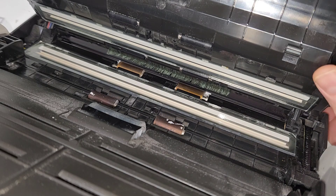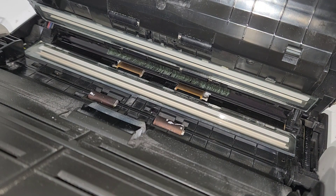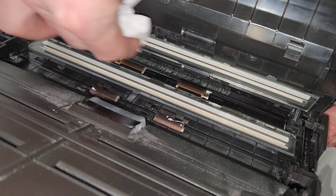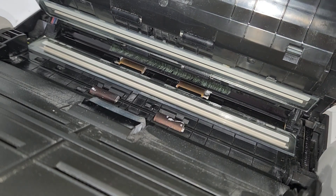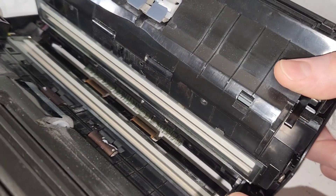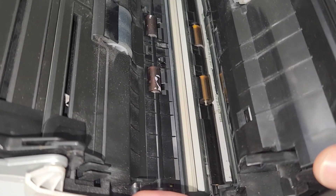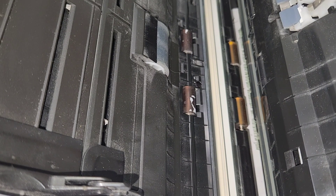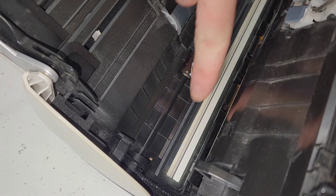Sometimes there's whiteout that you may need to rub for a little bit longer. Also, sometimes it's not as visible — it can give you just a very thin line, but it would be visible on your scanned document. So just take a closer look, inspect it all, make sure it's clean. It's much better right now. You can see how much of a difference it is. Just go ahead and check it out — see if the scans are better. In my case they should be without any lines at this point. You can visibly see how clean and clear the glass is now.